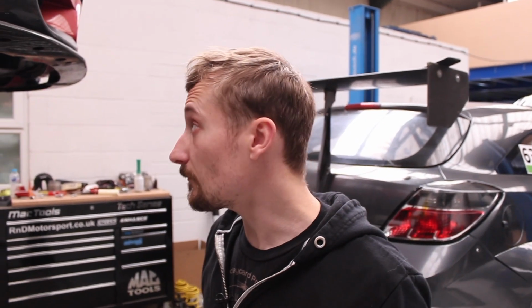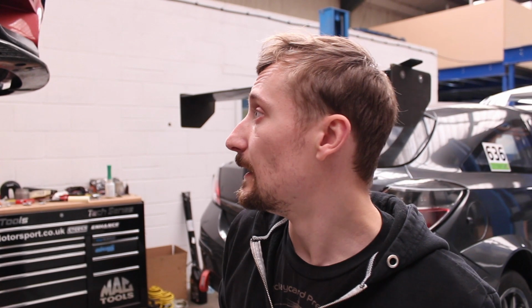Obviously hybrids can really only go so far because you've got the limitations of the stock size of turbine housing, and even with newer compressor covers and things like that, there are some limitations involved. So realistically the only option is to go to an aftermarket turbo, like a Garrett or an EFR, and that's what we're going to do on this.